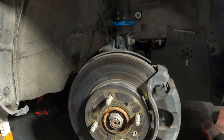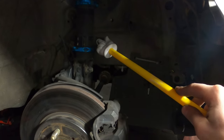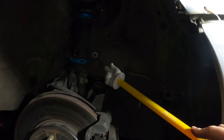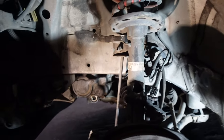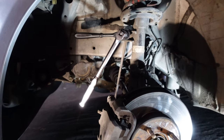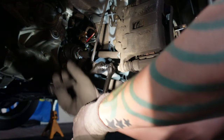The first thing I'm going to do is take your wheels off and get access to your sway bar links, which are going to be here. I have aftermarket coilovers so it looks a little bit different, but your sway bar links should connect here. Disconnect it from top and bottom on both sides — you're going to need an allen wrench to hold it tight, and I believe it's a 12mm nut to break those loose on both sides.